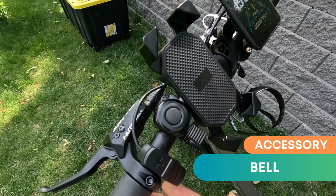So here are some considerations. First, the grips. More than most non-locking grips, they slip around easily, so that's something I'd swap out. Next, the front fork had some clunk to it, as you could hear in the first-person riding footage. That's one of the indications of this being a price point bike. While the inclusion of a 52-tooth front chainring was a good call, the 14 teeth, aka the largest gear in the rear, is limiting once you start getting into the 20+ mile/hour range.